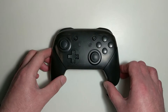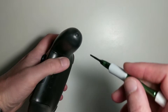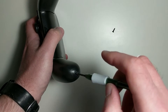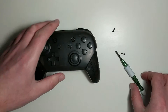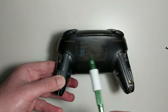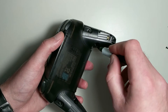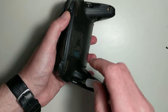The only other way to tell is to look inside the fake Pro controller. If you want to take it apart, the first step is taking the two screws from the handles — just two Phillips double-zero screws. This is actually the same as the official one; all the screw positions are the same. Pull the two little handles off, as there's nothing holding them in place. Next, remove the back panel — it has four screws holding it here, here, here, and here. The screw positions are the same on the fake and official, but they use different screws.